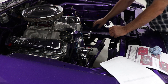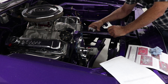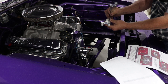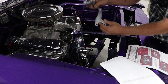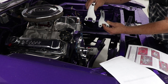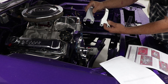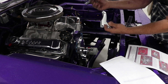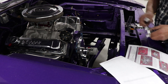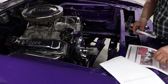I've got my studs in and my gasket set. The cool thing about this kit is they engrave the support brackets with their part numbers. When you open the packages the part numbers are on the packages, but once they're apart you can't mix them up. The instructions call out 40723-A for the power steering side and 40722-A for the AC. The spacer nuts go on and tie the water pump down.